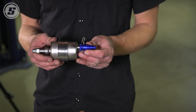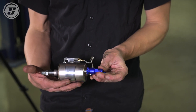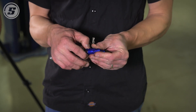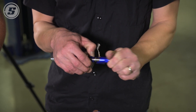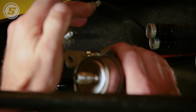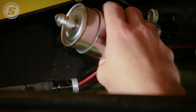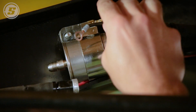We're standing here under our yellow truck and we're about to install this new one, replacing the old one. Here's an example of how they used to be — with the adapter, here's your GM plastic quick connect, and then this adapter fitting to go out to a number six male. This new design just cleans it right up, takes a potential leak point out by removing the adapter, and it should just plug right in place. We're going to put this back up in the spot of our old filter — same line, same length — so it should mount right back up and fire right back up.